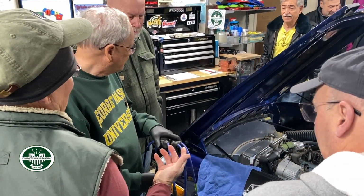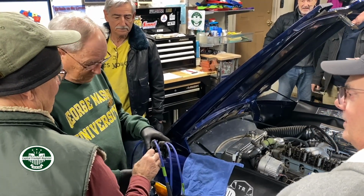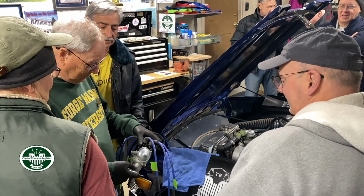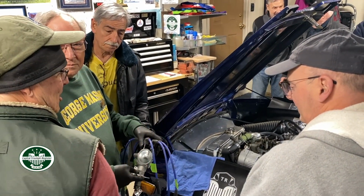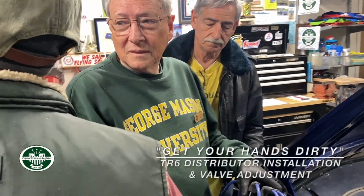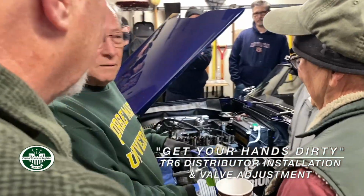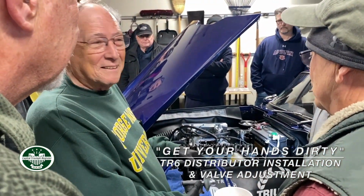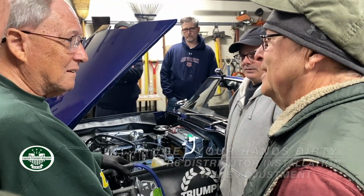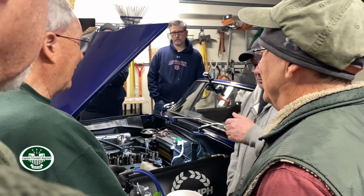It's going to change the acceleration. So for the advance, it's good for when you're cruising, and idle. But then he says no vacuum on the little car. That's what the other guy told us. He said absolutely no vacuum. Don't ever hook it up. Never. Why would you do this then? That's what's going to be interesting, because I think you might get better gas mileage and drivability when it's idling. With the vacuum you'll get better performance, coming off a stop sign, essentially.